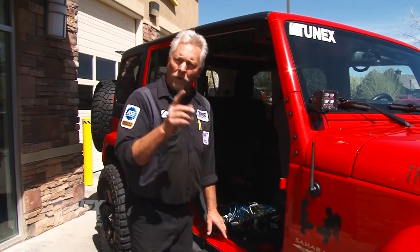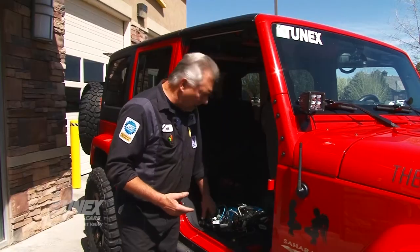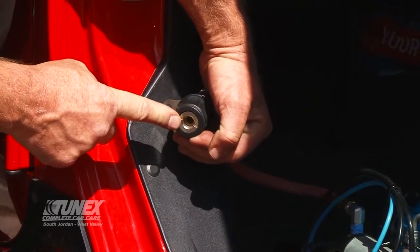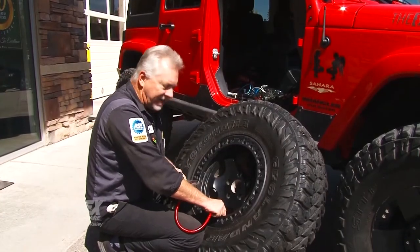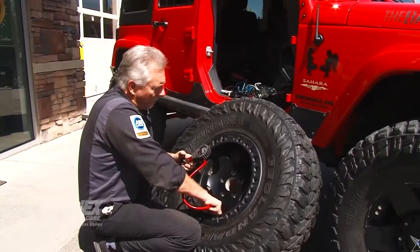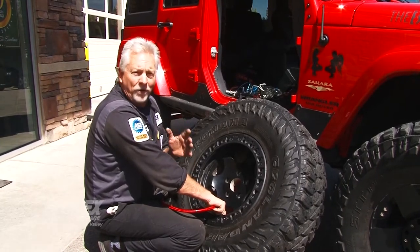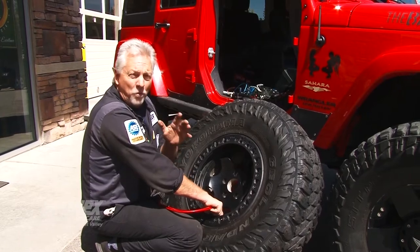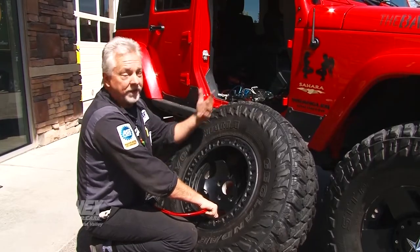Now we're at the Bad Influence. This is our friends Keith and Linz — this is their Jeep. What we've installed is this nice ARB twin compressor system. He also has a fitting here that he can connect a hose to out the passenger side door. Let's put this to the test and see what kind of air up we get with a 37-inch tire using this ARB system. On your mark, get set, go. Okay, there's 30. Time: 1 minute 42 seconds. They were literally just three seconds apart between the Warn and this ARB system. It's got great capability and he can utilize it for all his onboard controls as well.